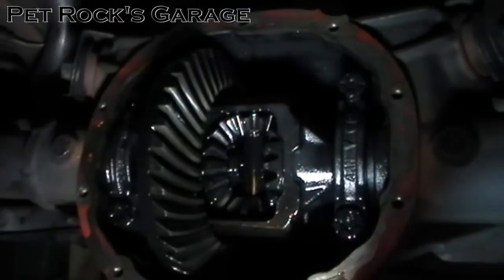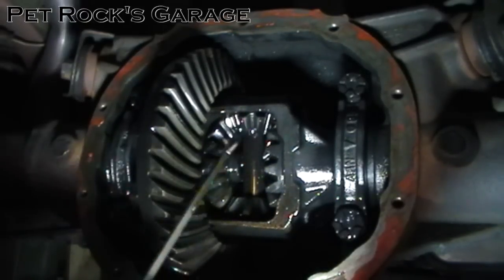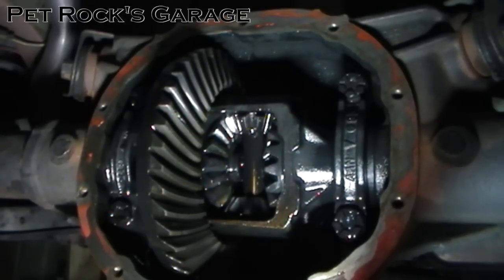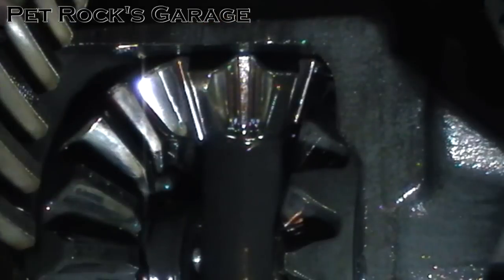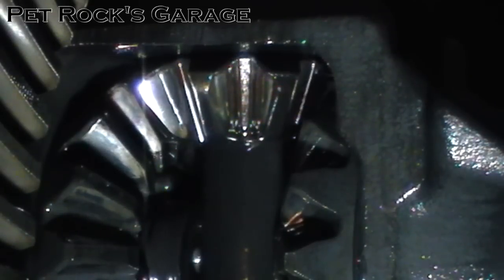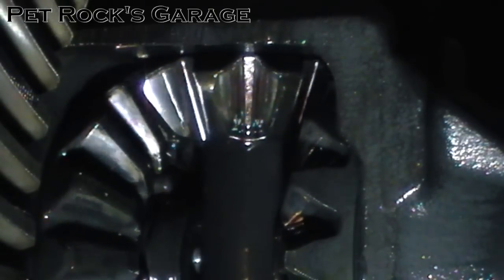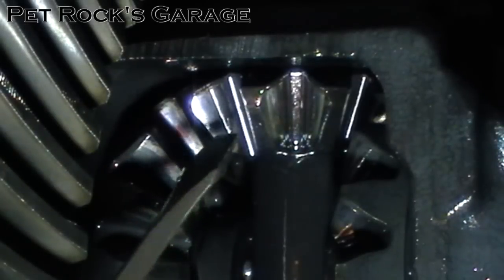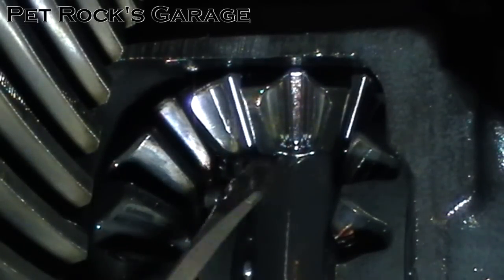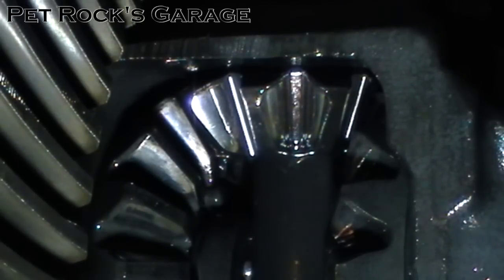You should also rotate the spider gears by rotating one of the tires in one direction or the other. You want to inspect all the gears — move them back and forth, and that will discover problems like I'm having here where this gear is actually loose. If you look closely as I slowly move one side, you can see this gear moving up and down — it shouldn't do that. You can also see it when there's no tension on the gear.